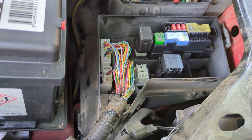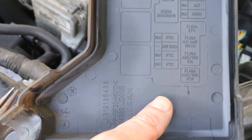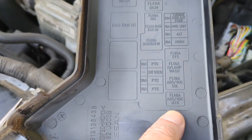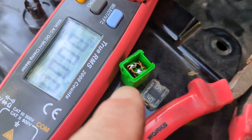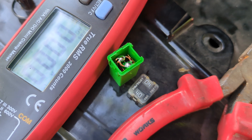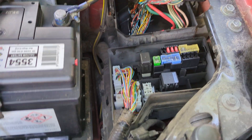I got access to the second fuse compartment down here, and it turns out — there you go — ABS, it's that one down there, that 40 amp jobby. Sure enough, I pulled that — there's the inside of it, by the way — it's a 40 amp automotive fuse. And that did the business.